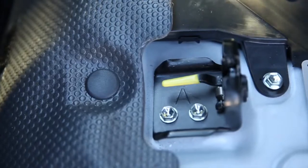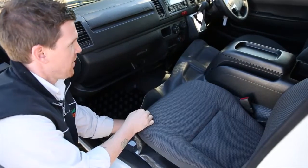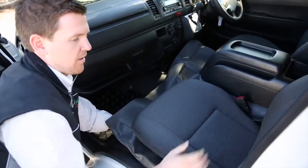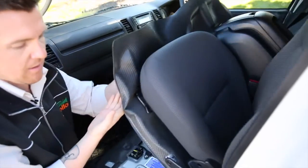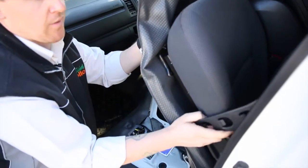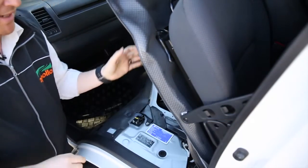There's a second lever underneath the seat with a yellow handle. That gets pushed back towards the driver's seat, which disengages it. Then the back of the seat is folded down to enable the whole assembly to lift back. There's a strap on the side which can be connected to the side of the van to hold this up while you're accessing the engine bay.